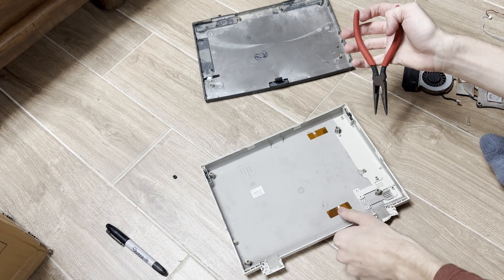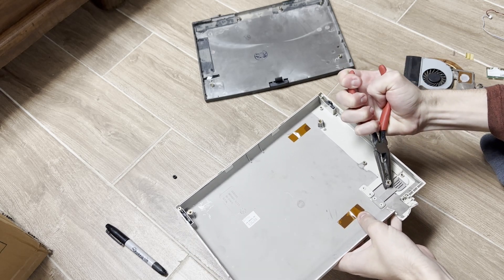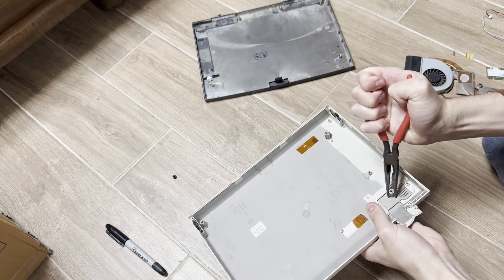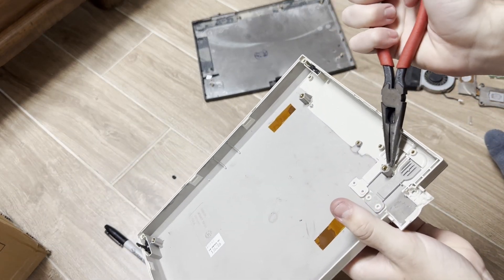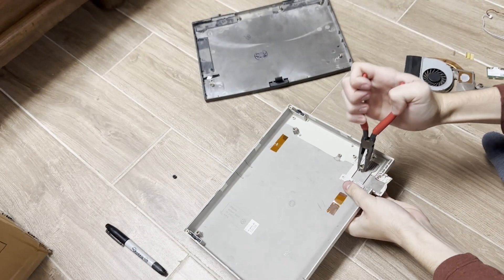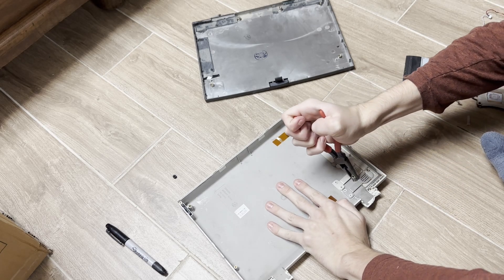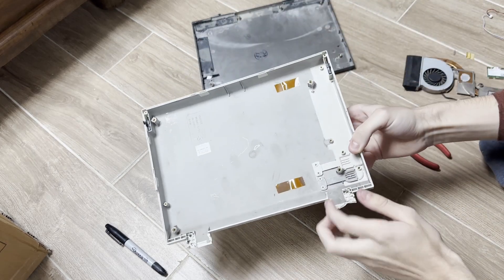Step one here - let's see how much it takes to bust off one of these LCD standoffs. Well, that's putting up a fight. We're going to do the LTE Lite first, and then the Winbook to see the comparison. Look at that - that's taking it like a champ. These are pretty big mounts, of course, but still. This just isn't giving in. The whole housing is bending. It's very notable - this plastic is deforming, not breaking. So this is still good. It's not brittle.